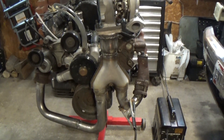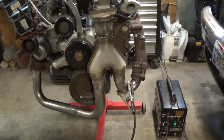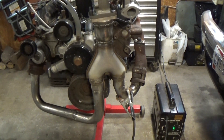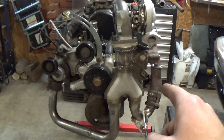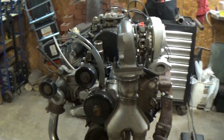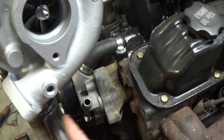I am going to pull it off, get the turbo off and pull the pipes off, fully weld it, bolt it back up, get it completely snugged down because it'll be the last time it comes on and off for a while. Then I'll get the turbo bolted all the way down with a gasket in it. Before I put the turbo back on I want to make some sort of support strap here just to keep things from wobbling around.